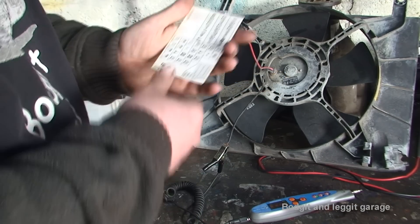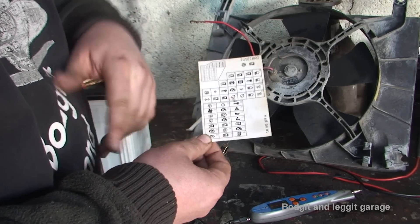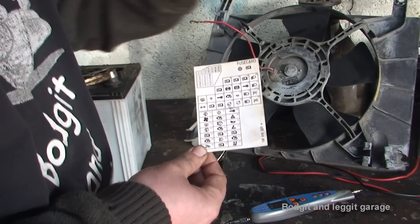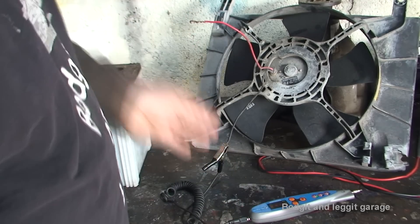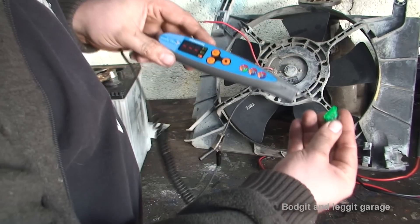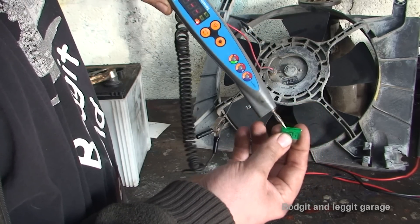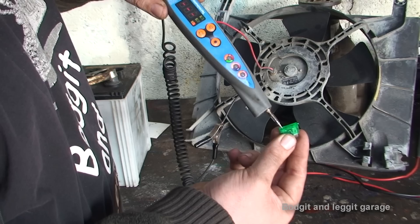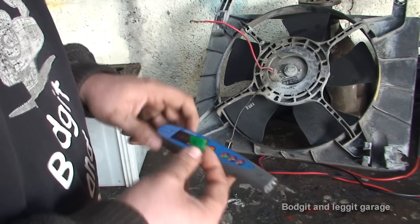You can also measure fuses with this. Most cars come with a little board that tells you what fuse does what, but it might have got lost or the numbers might not be on the actual fuse box. Rather than pulling out every single fuse to find which one is gone, if you earth this to your car with the car turned on, and plug into the two little metal contacts on the end of each fuse — if one side reads 12 volts and the other reads zero, you know that fuse is gone. If both sides read 12 volts, the fuse is okay. Very quickly you can go through all your fuses.